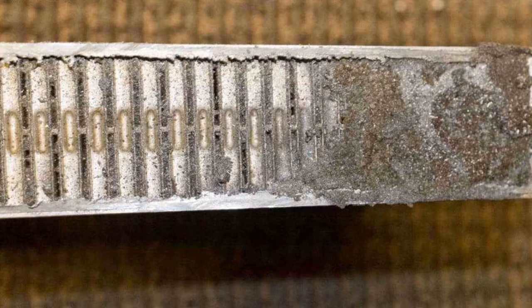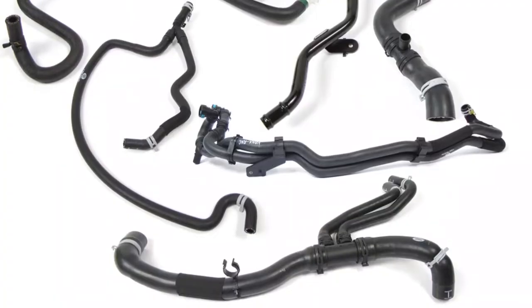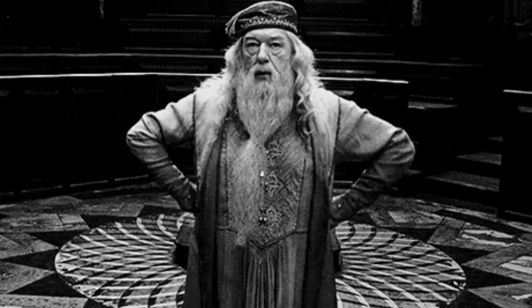The automatic thought is a clogged heater core, which is correct. While you replace a water pump and such, be sure to do a full coolant flush. If this still does not work, a few people have talked about squeezing the coolant hoses going into and out of the heater core to help burp or unclog it. Not a hard fix at all — you just have to be patient.